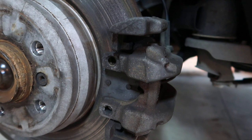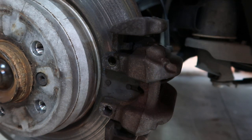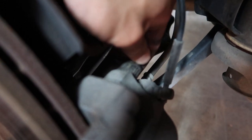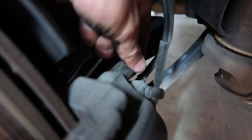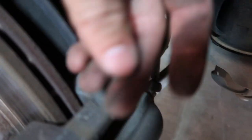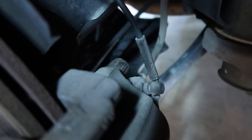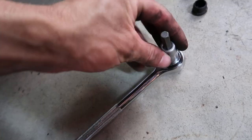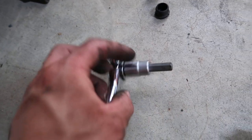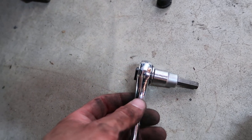This being the passenger side, the brake wear sensor is here and I'll show you how that goes in. This is where the bolt pins go in on the back side that hold the caliper to the hanger. You've got to pull these plastic caps out — there's one on the top and one on the bottom — and that allows you to get an 8mm hex in there to pull those pins out. I take an 8mm hex on a ratchet and go in and loosen the pins to the caliper.